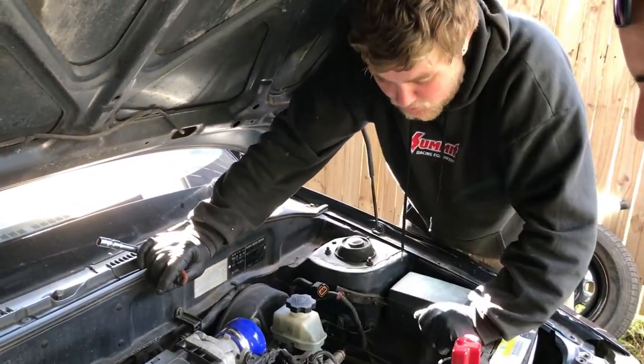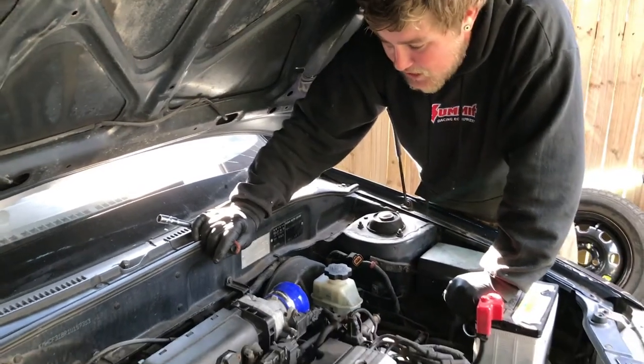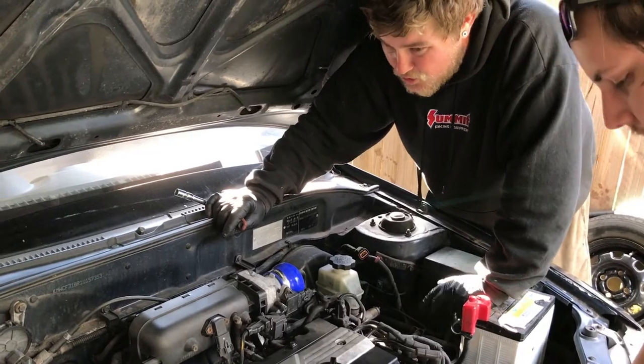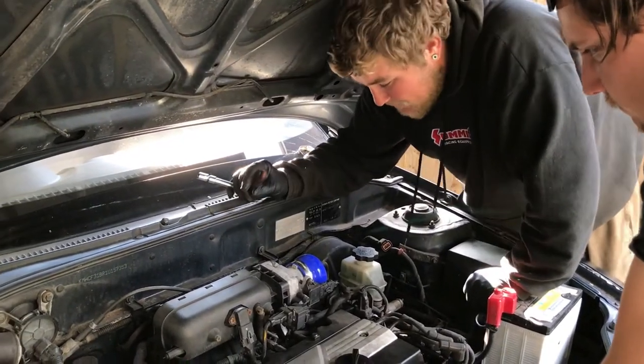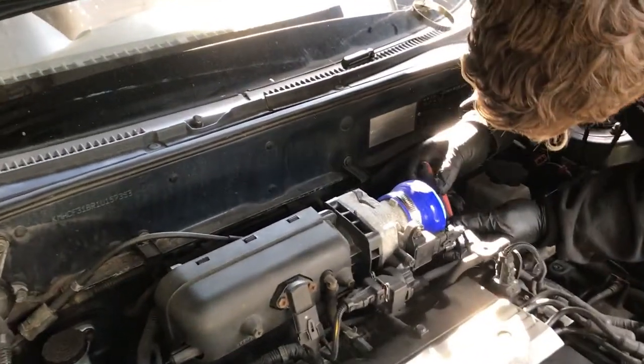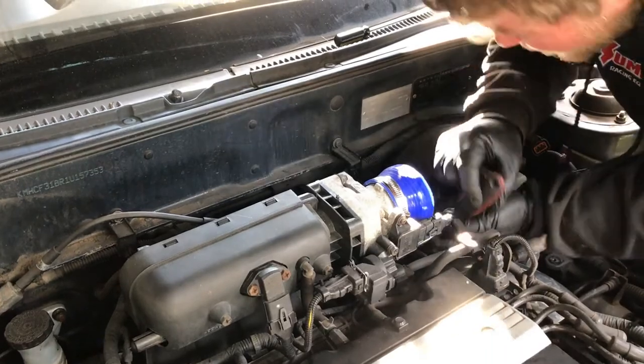We've got our new colder spark plugs in there. We just had the vehicle running. See how it ran? It actually ran a little bit better. I don't know if the previous owners put the wrong plugs in this thing and I've just gone to a normal style plug for it. But if you look at the packet, what I should have done is gone colder, or in theory, I've gone to a colder plug. But it seems to be working pretty well for us so far.